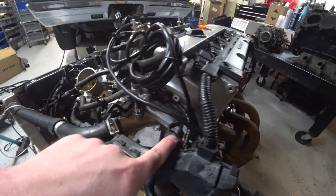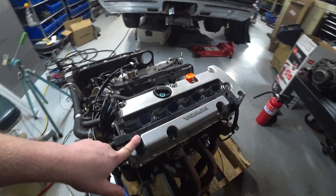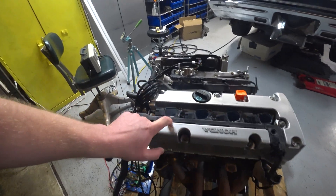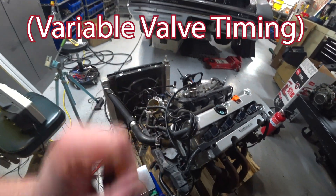The next day. The crank signal is down here, and the two cam signals are at the back of the head. Each cam has its own signal. We're using the exhaust cam to trigger the sequential because this cam is stationary. The intake cam obviously can be varied, so we don't use that for triggering.